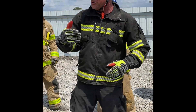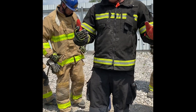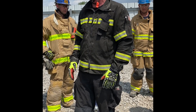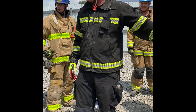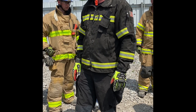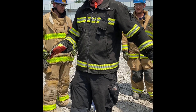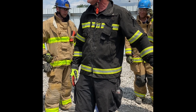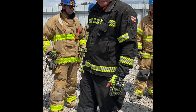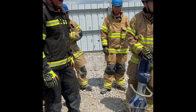In our time test — and I'm going to push you guys again on Thursday when you're doing your evolutions — rip and blitzes, good crew, full side out back to front, maybe you're running three minutes somewhere around there. This technique, good crew all dialed in being intuitive: minute and a half max and you're down, you're through it. Even if we have to work on top of the doors, that's doable for quick access. The B didn't blow out so it's cake icing — really, really cool fast way in. Pull that out, we're going to jump right into a blind dash lift.